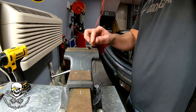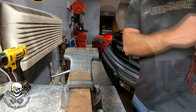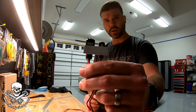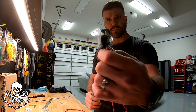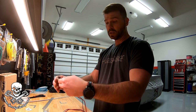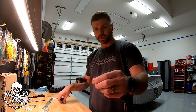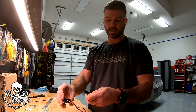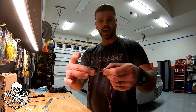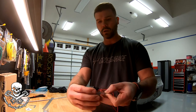I did a quick test fit — that one's perfect. Now trying the bigger one. Step bits are the trick: 5/16ths and 7/16ths, and we're all said and done. That is what we ended up with — a nice little custom bracket that will look better than OEM when it's actually in the vehicle. For example, the passenger side front will mount up just like that, and the bracket will go underneath the dash somehow to hold it in position. Then the wiring will run from there.